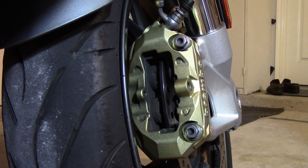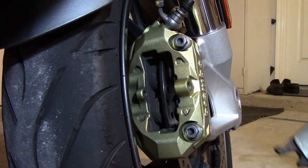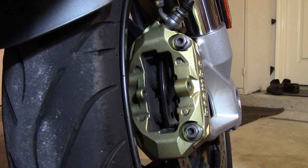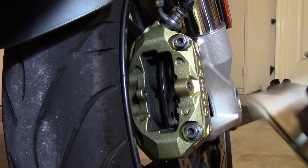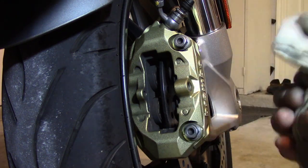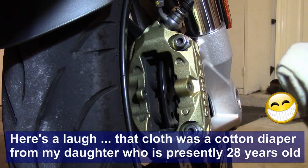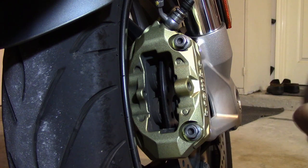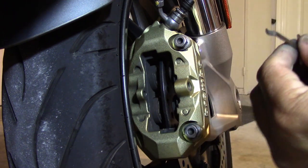So today's job is going to be much easier and quicker — I'm not going to be changing my pads. What I might do is just wipe them up. Now that I've got them out, I'm going to clean up and put a little grease on the pin. Keep this cloth away from the friction material — you wouldn't let the friction material come in contact with anything greasy, or else you instantly have to change brake pads. Don't touch any greasy surface to your brake pad friction material.